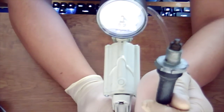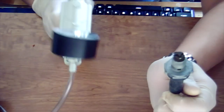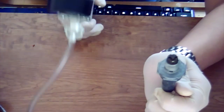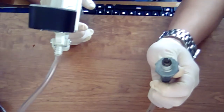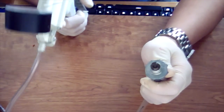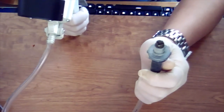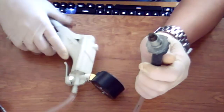Just take a look at that top stem there — it starts to go down, and then it goes all the way down. It appears the first engagement happens when vacuum drops below 10 inches of mercury, and then the second stage is around 5 inches of mercury. So when we get below 10, we start to see the first stage — I felt it click a little bit and it starts to open. And then when it drops below 5, it really opens all the way. It continues to open as it approaches zero.